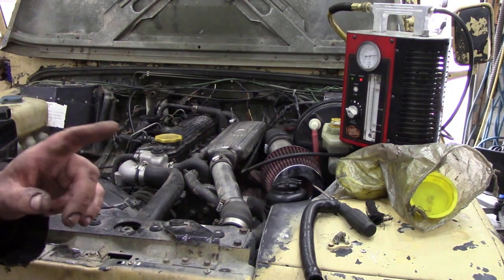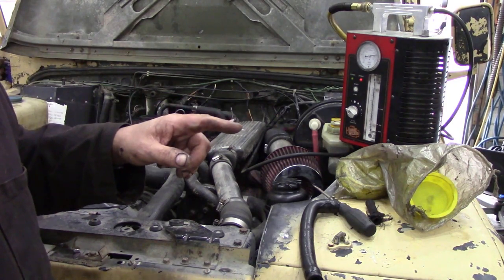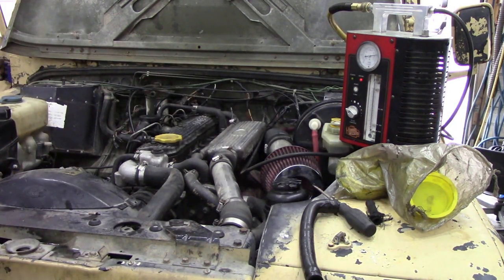The thing I'm testing currently is the transfer box. What we're going to do is two tests at once - test if the plastic pipe has got a kink in it, because the manometer has gone right down to the bottom, but it could be a kinked pipe not letting the air through. So I'm just going to crack off the pipe on the transfer box - and you should hear it. See, there you go, now it's bubbling away. I'll shut it down, take off the nut and put the nut back on.